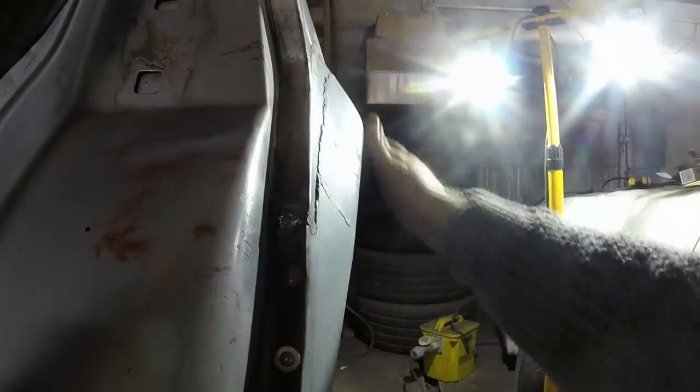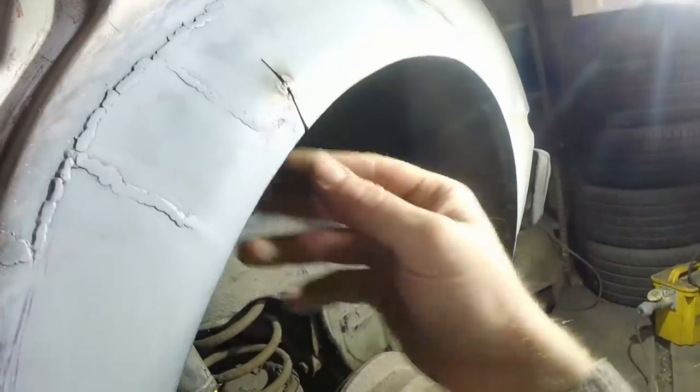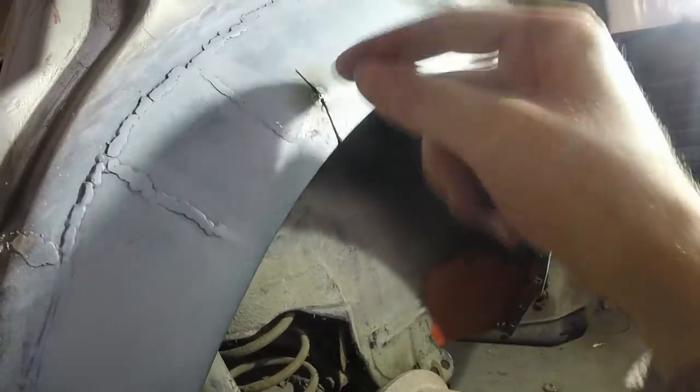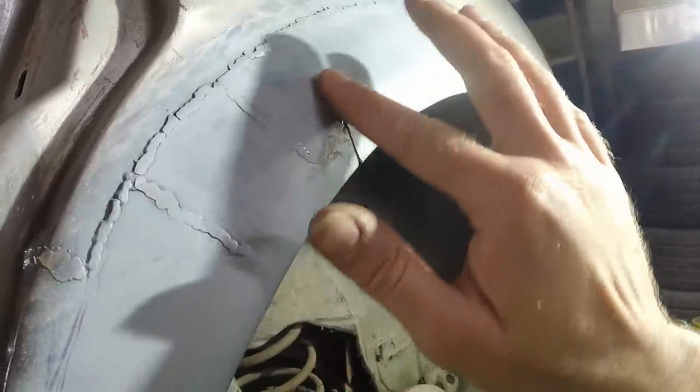The guys at the body shop are really good with filler and curves, so that there could be tucked down. I'll just put a tack in here. Can you see how that bit is high over there? I might tack that bit, extend that cut through to about here, hit that low, and then weld it up.